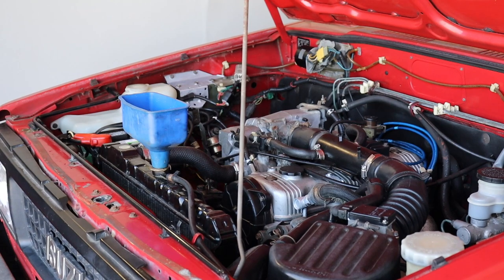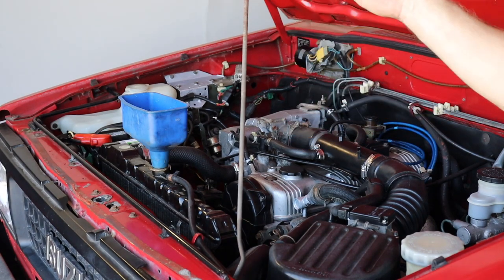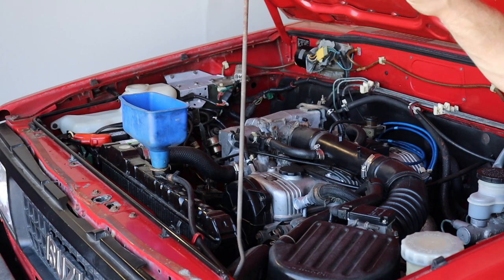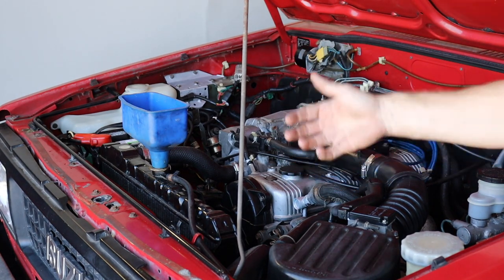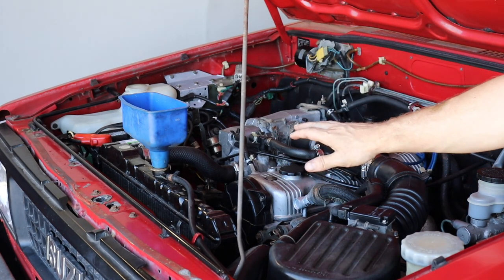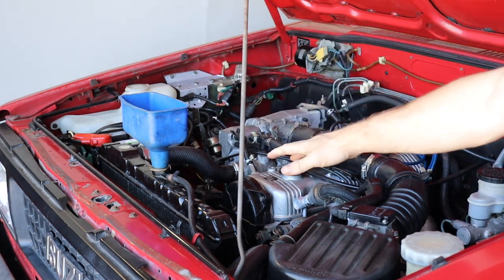Cut the vehicle off after reaching operating temperature and holding there for a little while. We're going to let it cool down and then drain that water out. Remember it's just water, but I have a feeling it's going to be extremely dirty and still have residual rust, crust, and some of the ThermoCure cleaning chemical that we had in the system. Let's give it about an hour or so before it's safe to drain.